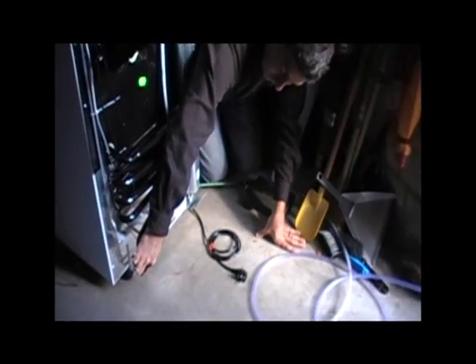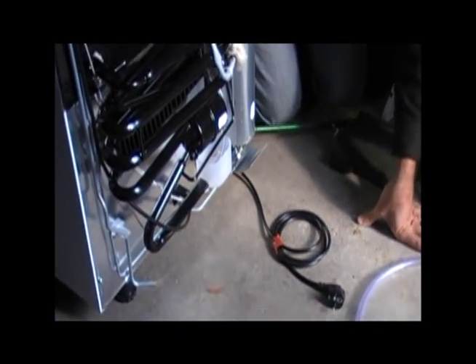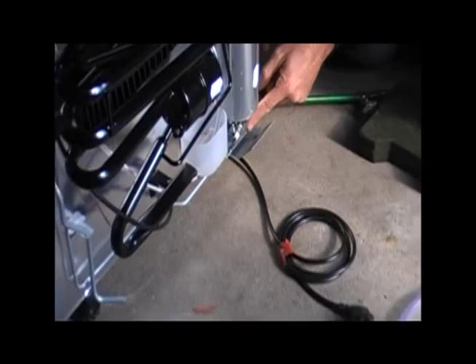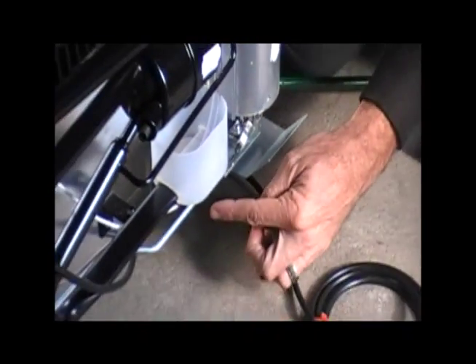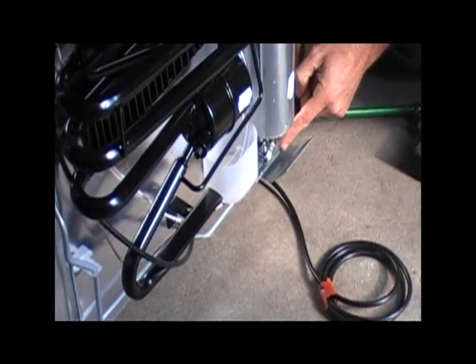This here is where you would put the propane. If you had a gas bottle under pressure, it would go here up to the control unit and then back down this thin silver pipe, which then goes into here and right into the chimney. Instead of using that system, which you automatically regulate from the front of the refrigerator, we're putting the gas directly into the chimney.